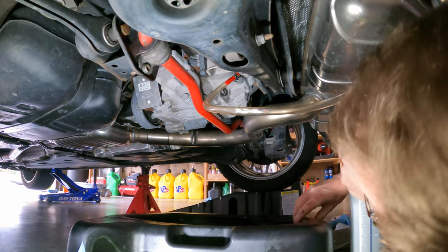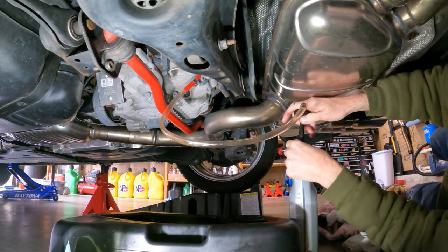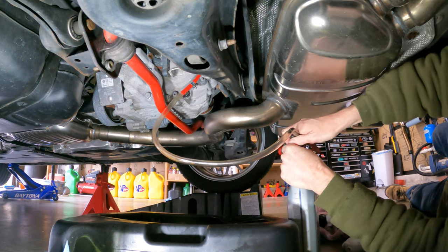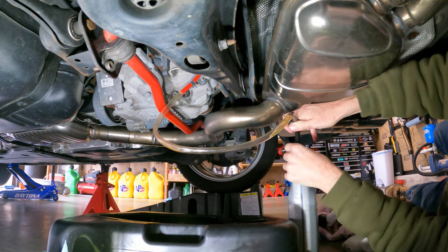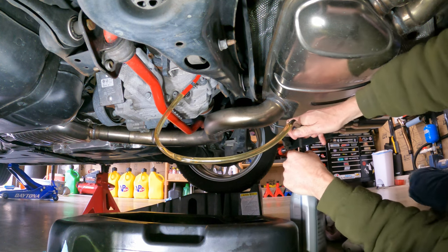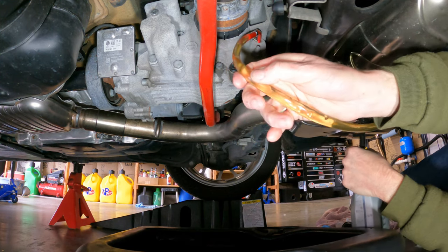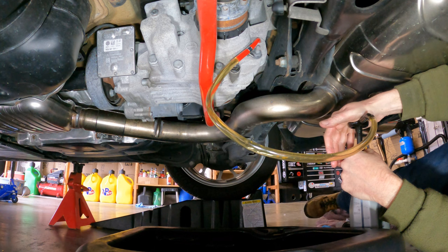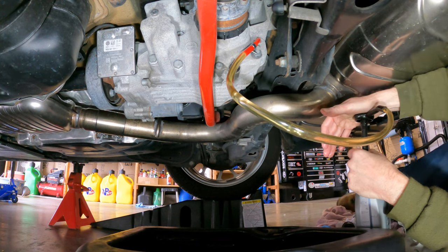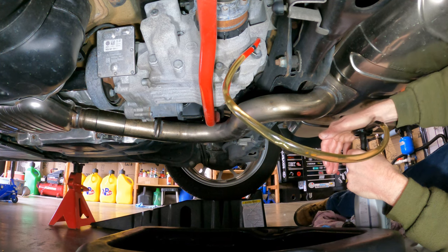Move this in and just pump until it leaks and we're done. I'm going to hold this, clean up later — it's a mess. Here it comes. It's a lot of hose to be filling up with fluid as far as waste goes. When it spills out it spills out. I like watching the bubbles — you know it's moving. I haven't even made a dent in this bottle yet, it's still at 900ml. Slow — you've got small hoses, don't push it hard all of a sudden or the pressure is going to pop out and squirt everywhere. Slow and steady, this will take a while — it's all about patience.